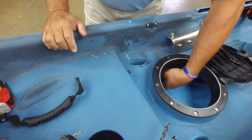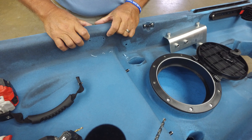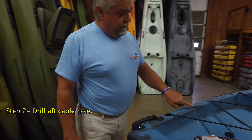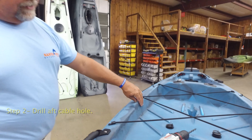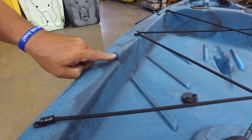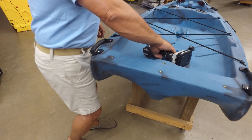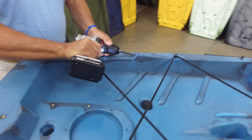When you get the kit, you'll have a laminated cardboard jig. Key to using it is lining up the top two holes as a reference point, which leaves three holes in perfect location for marking. The two holes closest to the rear of the boat are 3/16ths holes. The front hole is a 5/16ths hole for your actual lever control. I upsize these to a quarter inch because it's a blind plate and the oversized holes make it easier to line up.